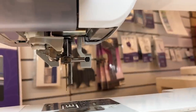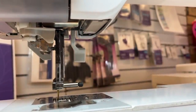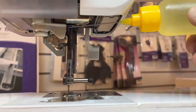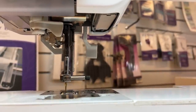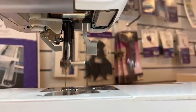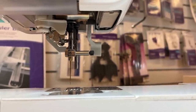To have prevented this: once a month, bring down the needle bar as low as possible, then take a precision oiler and oil as high up as you can, and then bring it up as fast as you can. Two drips of oil — one on the front, one on the back — once a month. That's going to get oil on that lower hole that the needle bar rides up and down, and that's going to help prevent it from wearing out.